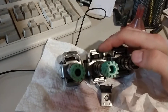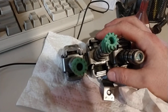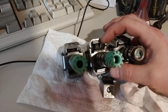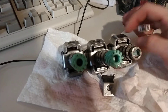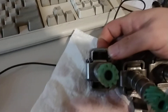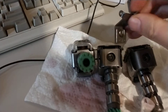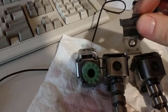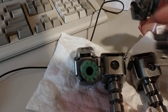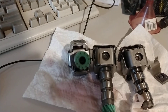I'm thinking it's probably a diesel governor — I'd love validation on that. The second one is roughly a stock one. I'm not sure about the springs, but the weight thickness is right for stock. If you notice, it's still a considerably thinner weight than the D series weight — this is a C weight. Then last but not least, you can see how thin that weight is. Unlike the others which have the weight riveted in, this one has no weights on it whatsoever. It doesn't look like it's been tampered with, but there are no markings either, so I'm not really sure what that means.